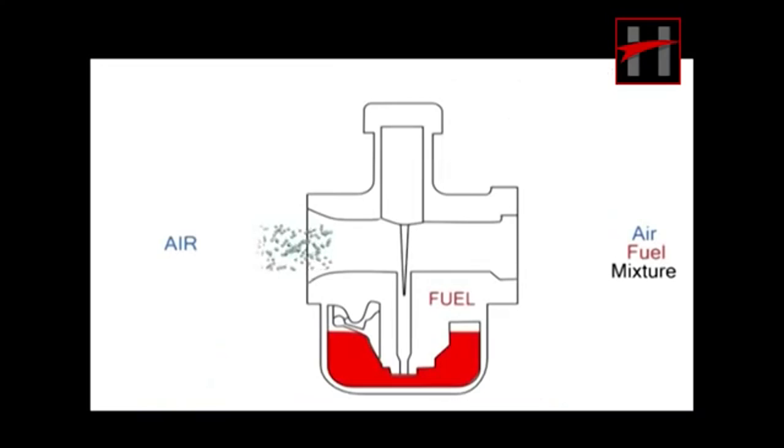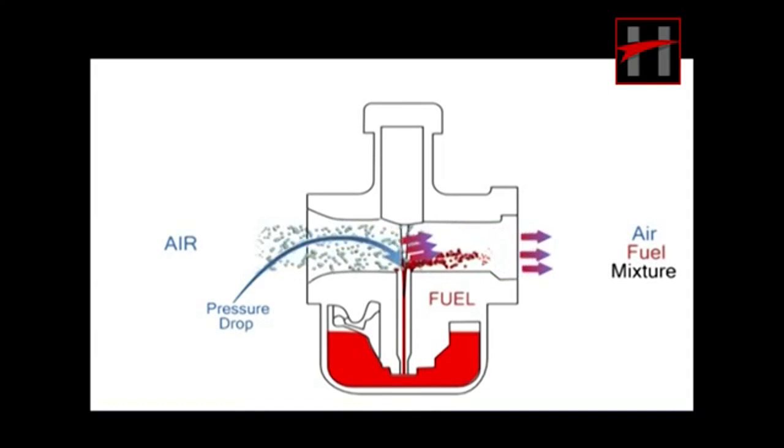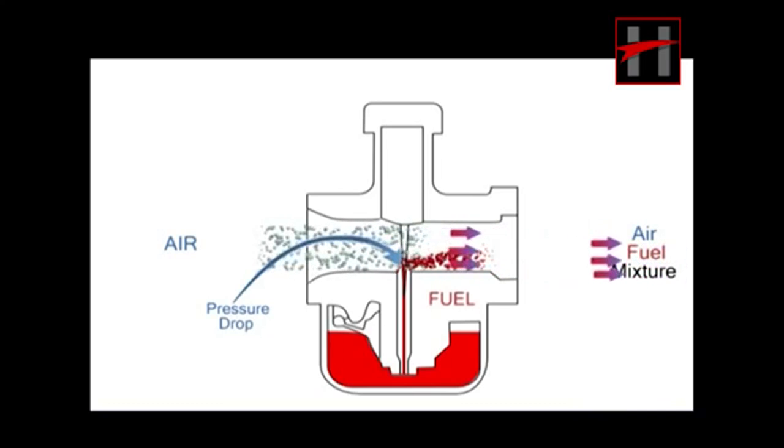But a carburetor is really going to help you get the maximum out of your bike and get the most performance out of your engine. When you remove some of the fuel, you can actually create more power. So lean is mean. If you're really rich, you're not going to make as much power as if you took some of that fuel out. The carburetor will let you take out some of that fuel and get more power out of your engine. You need to be careful not to go too lean, because then you'll blow up your engine. So there's definitely a fine line.